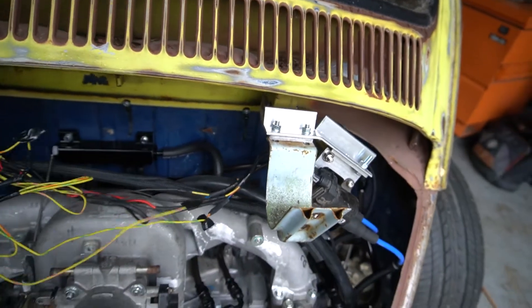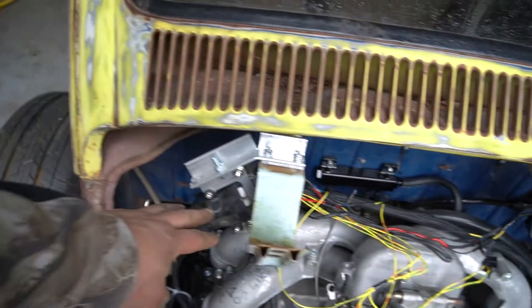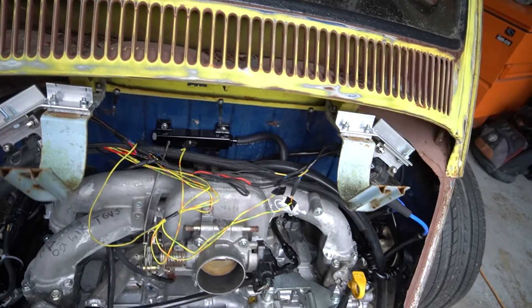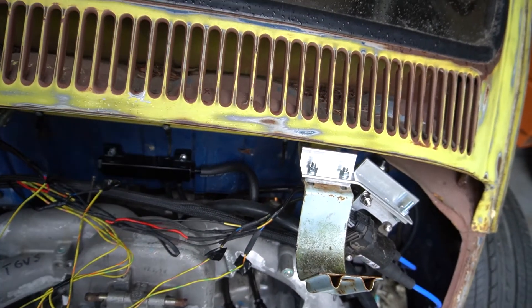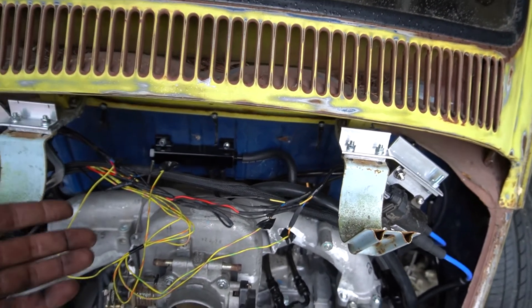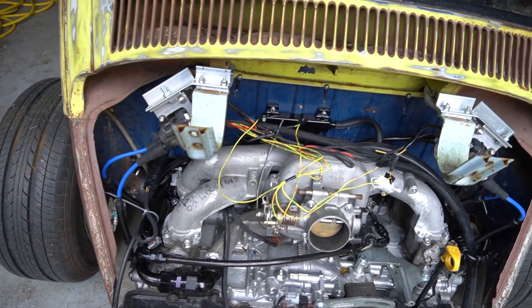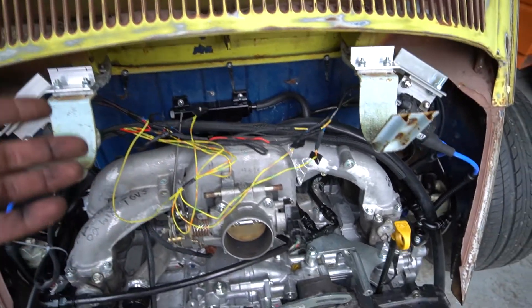I was thinking: faulty coil, or could a head gasket have blown? So here's my coil wiring — there are four wires, each one representing a different coil. I'm running LS coils, one for each cylinder. There was a bit of confusion on my part about what setting to run on the Megasquirt. I kept putting it on wasted spark and it would work, but only running on two cylinders. I kept messing around and finally came to the conclusion that my firing order was off — that's why two cylinders weren't firing.